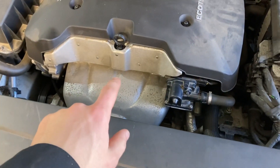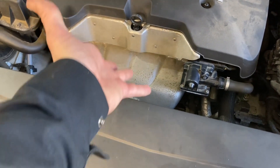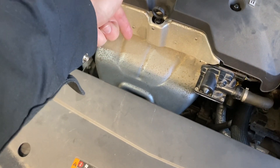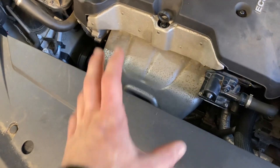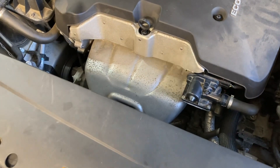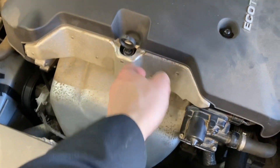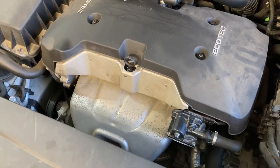The car is back together. I put a jack under the exhaust to lift it into place before the bracket was tight. I tightened manifold to head first, then cat to manifold, then went back under and tightened the bracket — it was located correctly at that point. I test-started it and made sure there were no leaks. The check engine light stayed off during the test start, which was great. I recommend clearing the code before the test start to give yourself the best chance. Put the heat shields back on, then the cover, and take it for a test drive. Make sure you don't have any exhaust leaks, and do a couple of cold starts to make sure the code stays away.